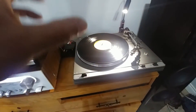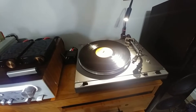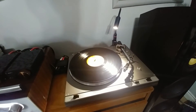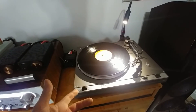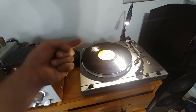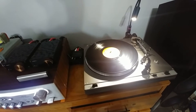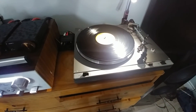I'm going to try actually taking the whole motor out and repacking it from top to bottom. It says to oil it from the top, but it probably needs oil on the bottom too — that should get rid of the noise. Surprisingly, the motor noise doesn't come through even when you put the stylus on the record and turn it up with headphones — I can't hear that rumble through the turntable. I thought it would transfer through the belt or through the cabinet itself, but it doesn't. Still, it would drive me nuts. I let it run for a couple of hours after repairing it yesterday. I'm probably going to keep it together, see what I find when I pull the motor apart, and see if I can shut it up. If I can, I'll include it in one of my vlogs working a bit better.